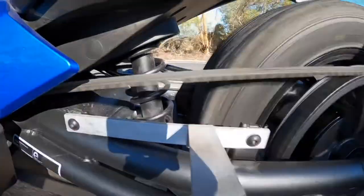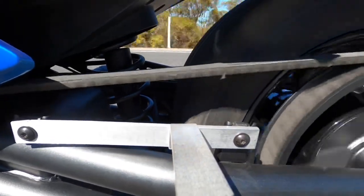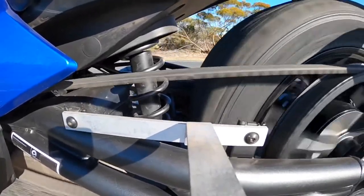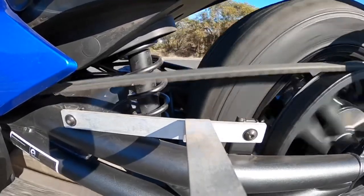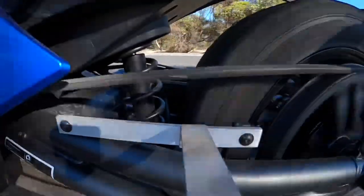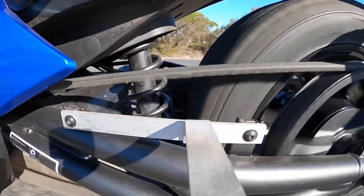I had it on what's called snail mode at this stage, then I tried another run and started to see a little bit of flutter — it was coming up quite steady and then I got some quite rapid movements. I put it into slow mode, which is 220 frames per second. I'm just on the edge here — I've accelerated up and then I'm just barely on throttle, not quite on and not quite off, and there it starts to really shake. Then I accelerate in top gear and you can see it's got a rapid movement — it really bounces up and down. That was the point where it went from lightly loaded to heavy load and the belt gets quite violent with a lot of movement.